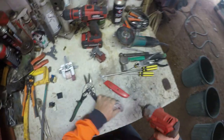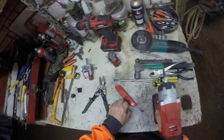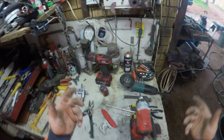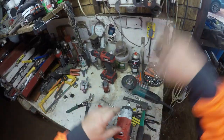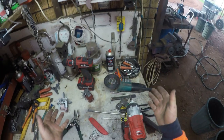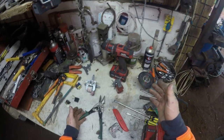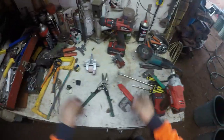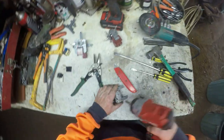Because if you put too much soap suds in your washing machine, there's a cast alloy spider in the back. The same as with the top loaders - what actually happens is your soap powder, whether it's liquid or powder, will eat that away. I do advise - because I pull a lot of them apart - grab a hammer once you've got the drum out and you can see the spider in the back. With a front loader, once you've got the flywheel off the back and you've got it split apart, hit it with a hammer and you'll see all your soap powder just fall out. It's still wet, that's why it's so corrosive.